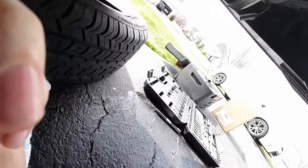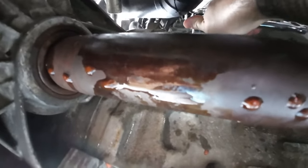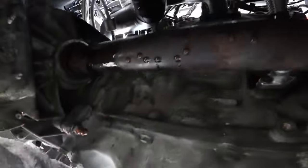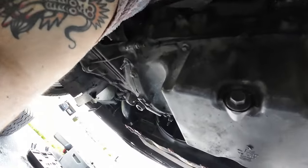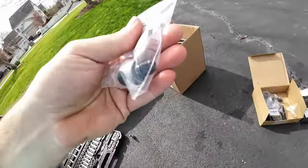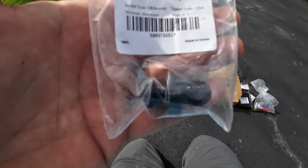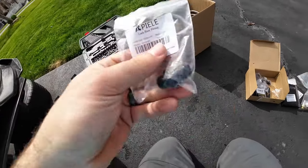Fitting is on — I'll give you guys the part detail. That's it right there. It came o-ringed, it's 19 millimeter, it's tight on there. Since it came with a rubber o-ring, I'm not going to push it and put any sealer on it — famous last words. It is dash-6 AN for my line. The part number for the coolant feed I will link down below. 6 AN, 19 millimeter socket — that's tight.